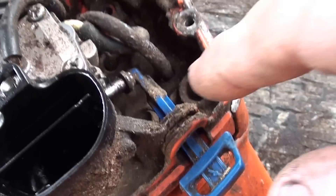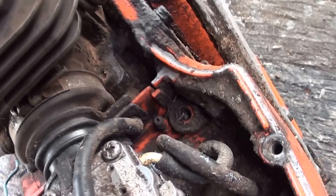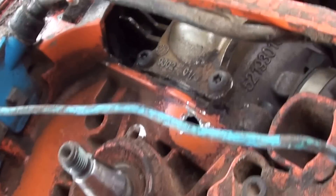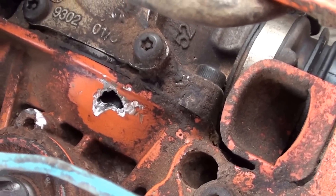In the airbox there are four screws and these have a tendency to work loose — and this one did. Let me show you what damage it did. See where it poked a hole right in the crankcase here — got under the flywheel and knocked a hole in it.